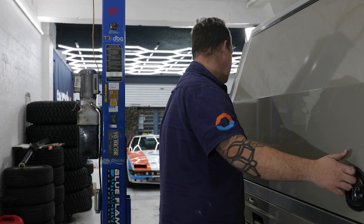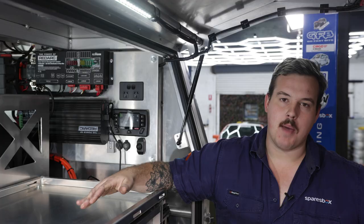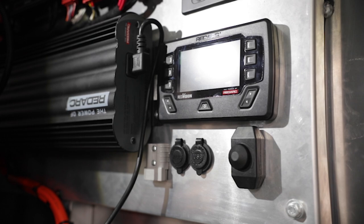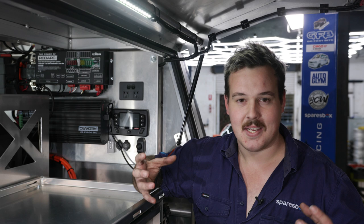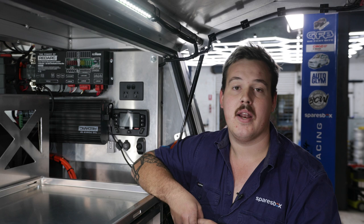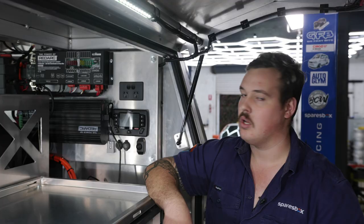This is the storage and 12-volt side. We've got more alloy drawers for clothes, bits and pieces, camping gear, as well as tray tops to strap down your big bulky stuff. The key feature is this integrated Mitt's Alloy 12-volt panel. We've got all the Redarc fruit you could ever want. The power source is a 200-amp hour EnerDrive lithium battery. Keeping it charged is a 150-watt Redarc solar panel mounted up on the rooftop tent that'll pump watts back into this system. Controlling everything is the Redarc Manager 30 and its extension, the RedVision system — an advanced piece of technology I recommend to anyone doing long-distance big-budget touring.